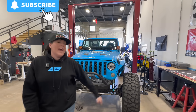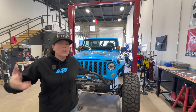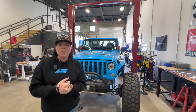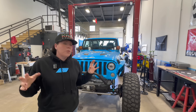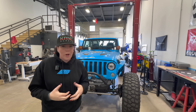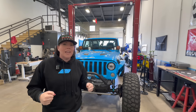Hello my lovelies, welcome back to the channel. Yes, I pulled my Shift Maker back in here. I thought I'd rectified the problem of that huge loud sound a couple of episodes ago, which is why we switched out that front driveshaft — you guys saw that the double cardan was done, it was toast. So we went wheeling again and the noise appeared again, a little more aggressive. So I'm thinking it's definitely something in the front end. I'm going to quickly tear him apart, get those wheels and tires off, calipers off and get into that spindle.